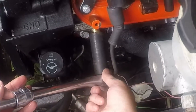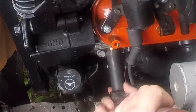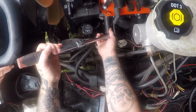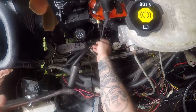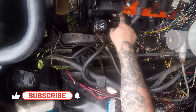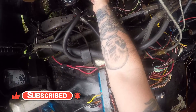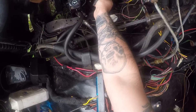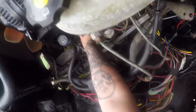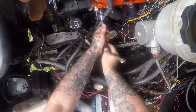Let's put this new sensor on here and tighten it. Like I said, that's what the copper washer is for. Got it — and don't over-tighten this because you can break the plastic and actually tear the copper washer. Now I've got to put my bolt back in where my eBay header didn't fit — yeah, they mis-drilled the hole. You get what you pay for with these cheap headers.